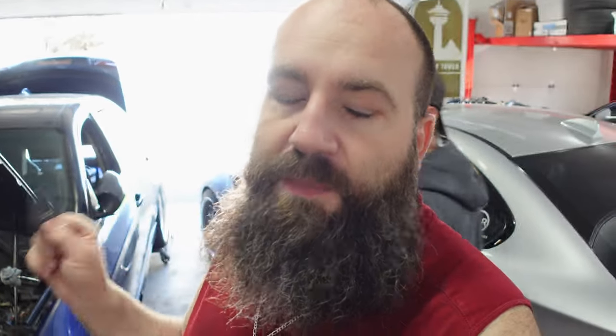Now, the downside will be he won't have the MHD backend flash on the vehicle itself, but because it has a 3.5 bar map sensor, it's all kind of stored in the JB4 technically, so we really shouldn't have any issues starting it. But again, we're impatient and we want to fire it, and I think worst comes to worst, because the other vehicle had lower mileage, we may get a tamper dot. So a tamper dot's essentially, I believe, on the gauge cluster. It just notifies whoever is looking at the vehicle that the vehicle's been tampered with.